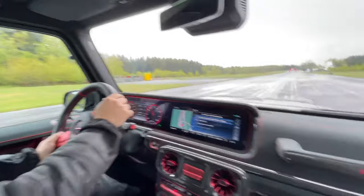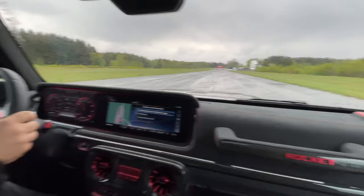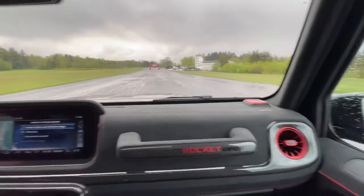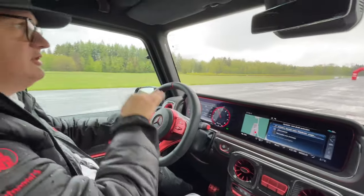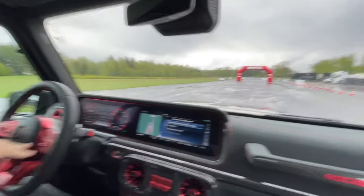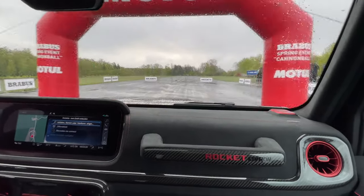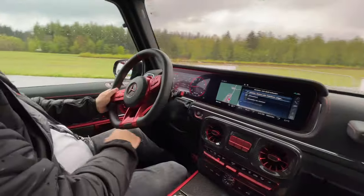We speak about body control, you know. We use the dampers to create high damper control, body control and roll control. The car is stable, it's stiff, it's settled, and that is what we want to have with a good compromise regarding comfort. Yes, hardly any body roll, and the ride feels very comfortable driving.